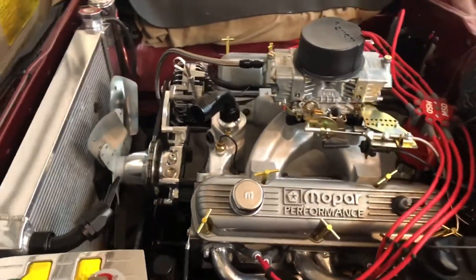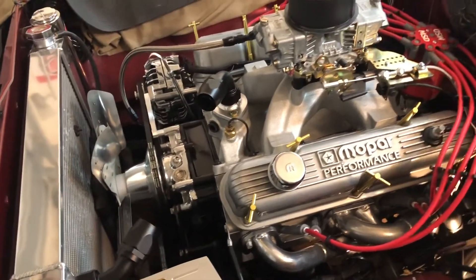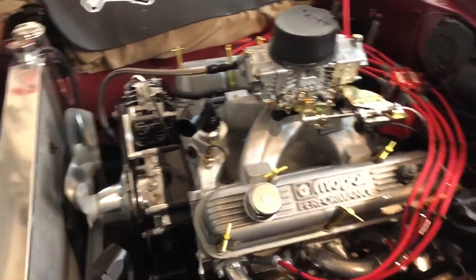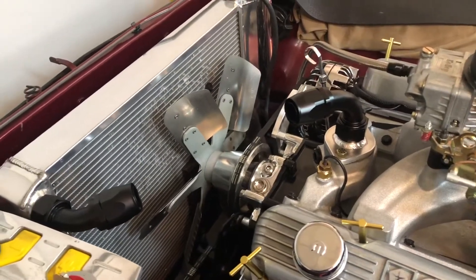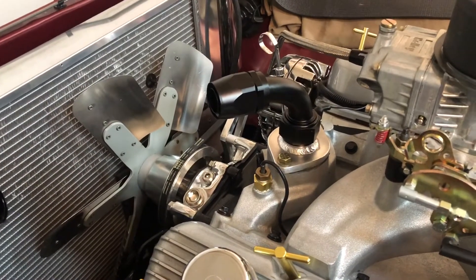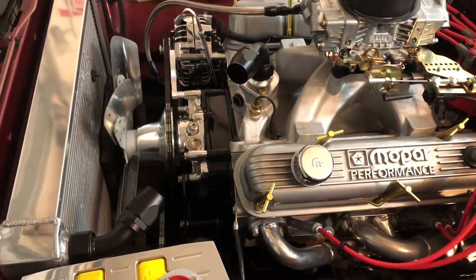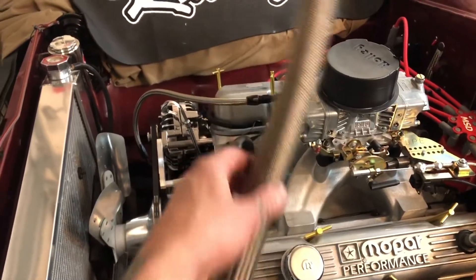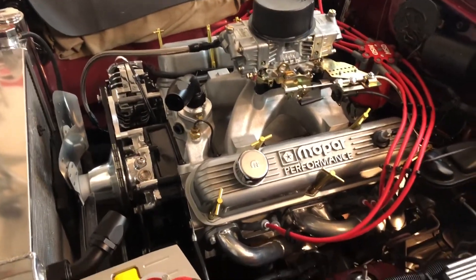Back home in the garage — got the radiator installed and put all the rest of the accessory drives on the front of the engine. This thing is looking so cherry. We got our dash-20 AN fittings in place, kind of mocked in position so we can simulate what hose length we need. You can see that's a dash-20 90-degree on our new welded thermostat housing, and that's a 45-degree on the radiator side. I measured about 13 inches, cut a piece of dash-20 hose, and now we head over to the bench to assemble the fittings and have the hose assembly ready to go.